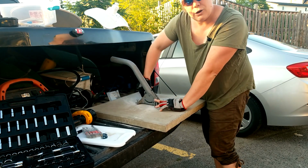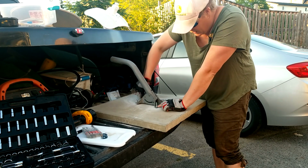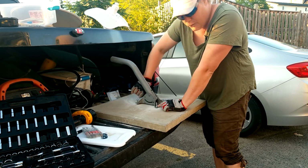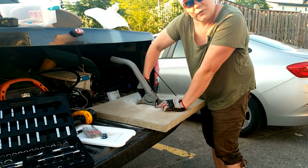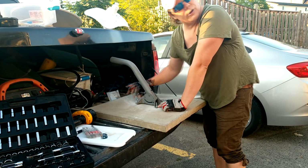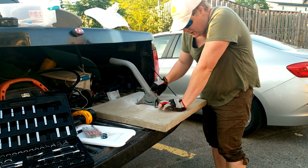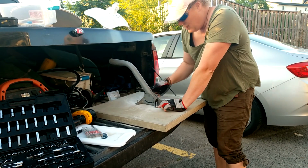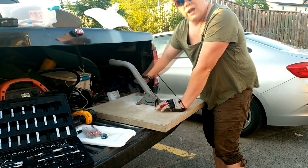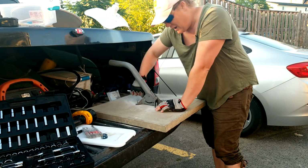Something which you can do, which is optional, is take a set of bolt cutters and cut that off right there. Kind of handy. Also, this is a great place to mount a ground. So if this is sitting on top of a trailer in a trailer park near a lake or on a hillside or a cliff or whatever, you may want to put a ring connector with the number 12 ground on here before you tighten down the nylocks. Why? Because of lightning. Chances are God doesn't like you, and he will strike you down.